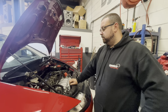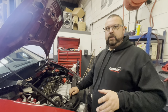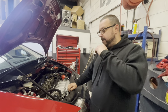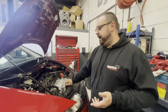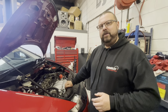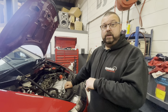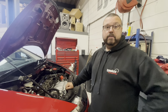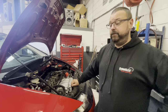Generally why do people make those mods? With the FN2 they have a balance shaft on the oil pump, and that costs a certain amount of power to drive that pump. So they look at deleting that and swapping to basically a normal oil pump without the balance shaft to free up some power. How true exactly that is I'm not entirely sure. Maybe it'd be worth tomorrow — we've mapped this car previously — we're only changing the chain and pump today, so it might be worth doing a run in the morning and overlaying it to see if it actually does make a physical difference. I'd be interested to see that for sure.